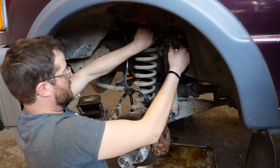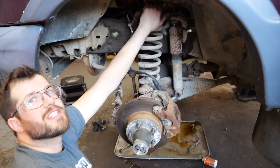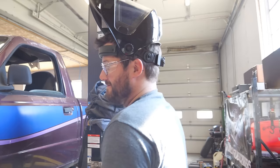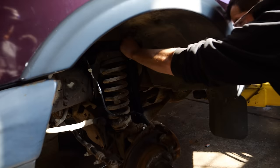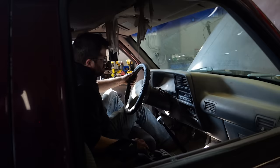How goes it? Well, going okay — I'm trying to replace the front shocks now. I managed to break the stud off that mounts it to the lower trailing arm, so that'll be a fun fix. We'll grind down the old weld, throw a ton of washers on that side... and we'll weld some threads on there. She actually worked her magic. Weld some threads on, surely that'll hold.